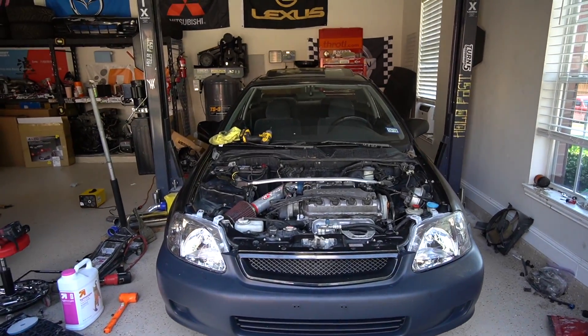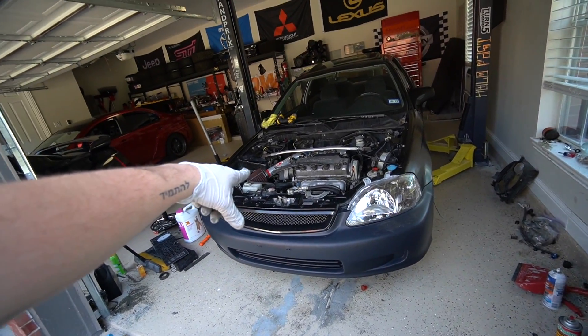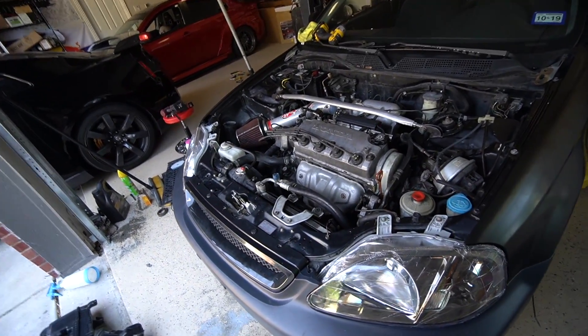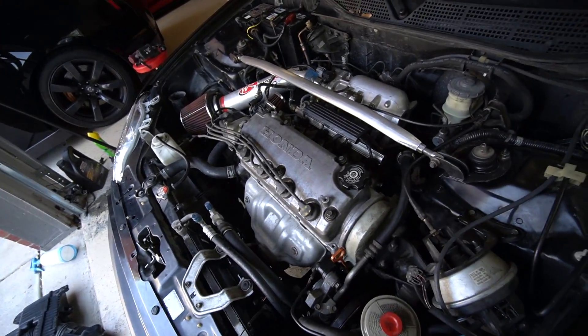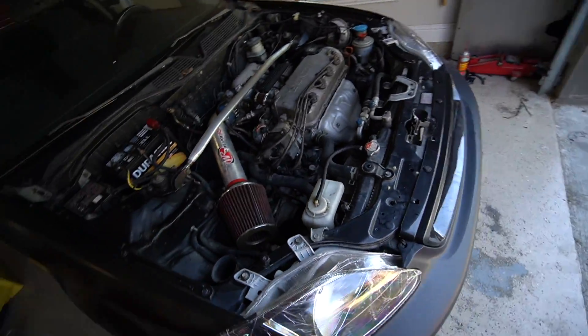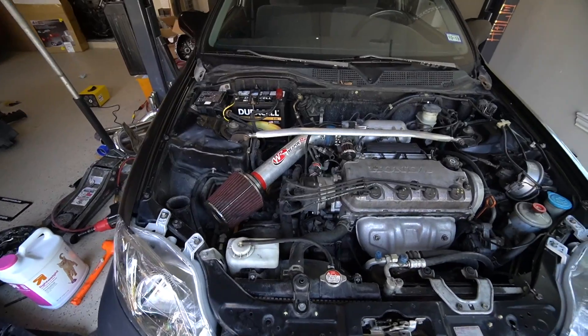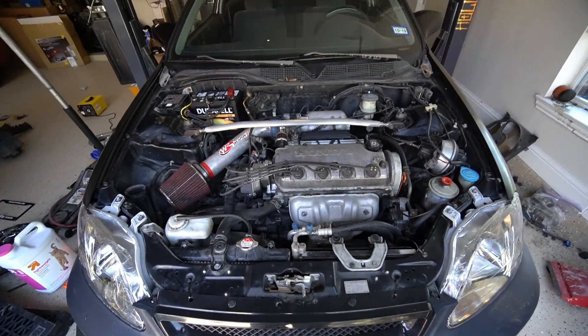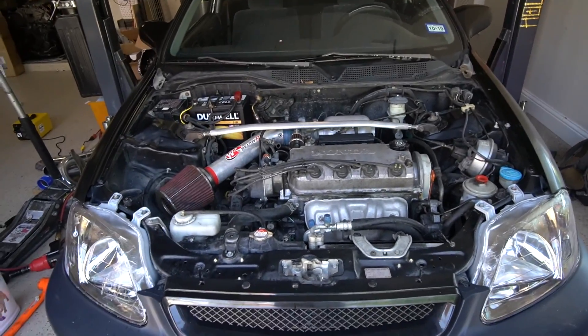Look at that, bro — that's JDM as heck if you ask me. Look at this little race car, dude. You think you're gonna want to take this rolling up 60 on a highway? No, you're gonna be like, 'Man, that Honda is fast.' Turn it on. The only thing this intake did for me was make it run really rich, which is what happens when you put on an intake without a tune. So you know what? I'm gonna go ahead and put the stock one back on. Embrace it, embrace it.